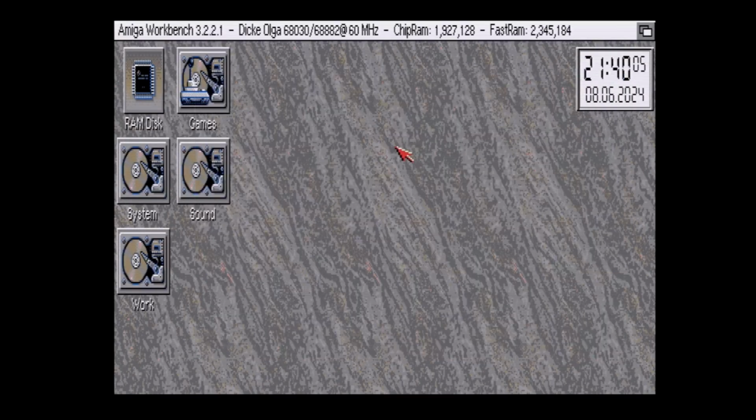So why would you use this mode? Because you might have some demos that don't run properly. Sometimes even with WHDLoad, it has issues with certain titles, cache related issues, all that fun stuff. It could be older games. In that situation, you could turn off the auto boot feature, and then you can boot directly off a floppy, and it won't even be aware there's a hard drive. So it pretty much turns off the card for the most part. So yeah, it's fun stuff, isn't it?